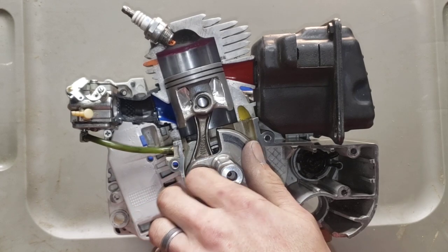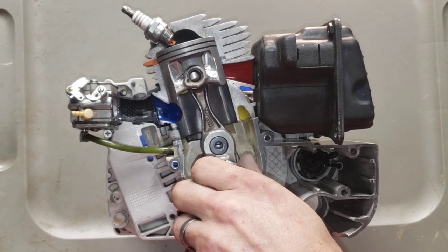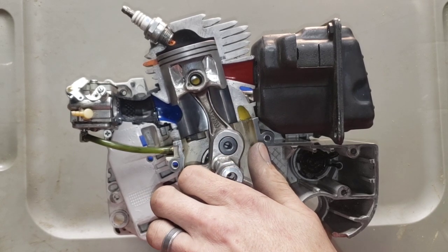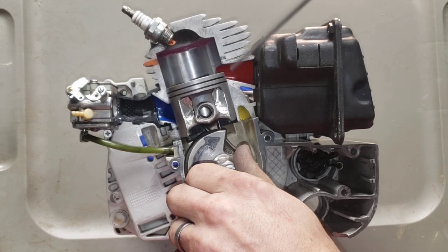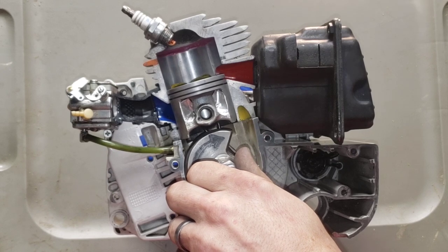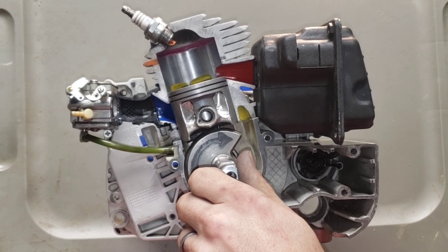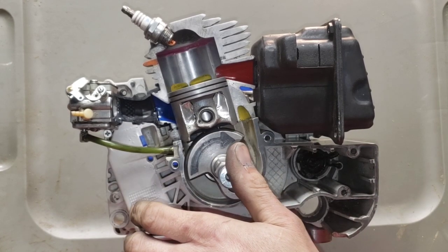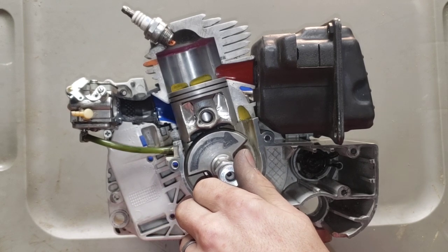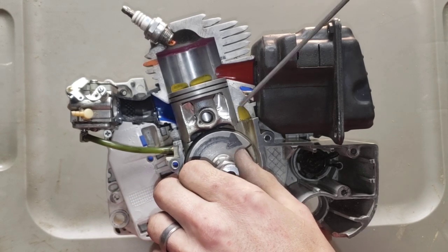This is really crucial. If you want to build a saw that blasts through smaller firewood stuff — lean machine, high RPMs — more power to you. But you're not going to build a torquey saw without some kind of machining to drop your combustion chamber. In a two-stroke, the lower end slightly compresses the charge, but I don't like to label it compression because people get confused, and I'm not here to confuse people.